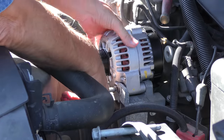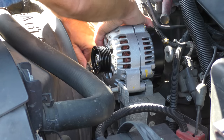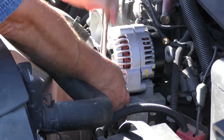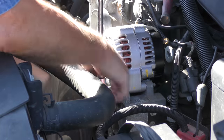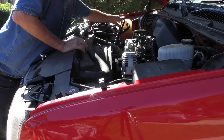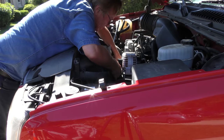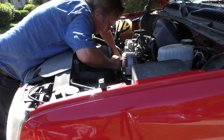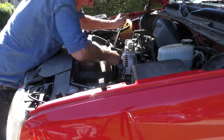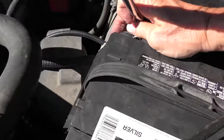Now you can see the alternator just falls into place — we don't have to wedge it anymore because the spacer went in. We tighten it up. Don't freak out about sliding it in — once you put those spacers in, it just slides right in. The bolts slide in, you don't have to wedge or pry. Get them on nice and snug, because when you get to the end it'll squeeze that washer and make it tight. Now it's squeezing against this — there, now it's tight. We do the other side, then put the power line on — 10 millimeter, that's snug. Plug the socket in, then pull on the big cheater bar to get the fan belt on. Make sure all the belts are lined up before putting them on, because if they aren't lined up it'll never work. Once lined up, the belt goes right on. Before you're done, make sure the belt lines up with all the grooves, then put the terminal back on so nothing shorts out.